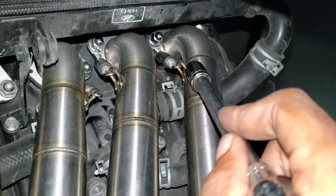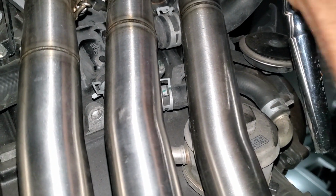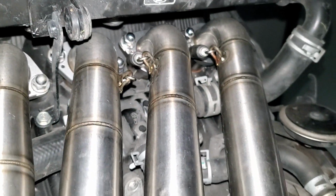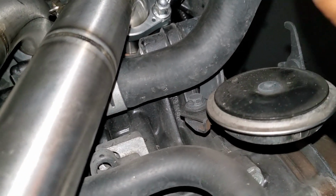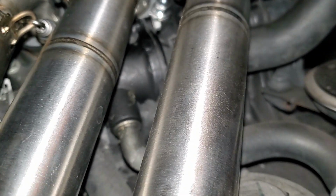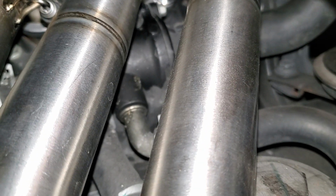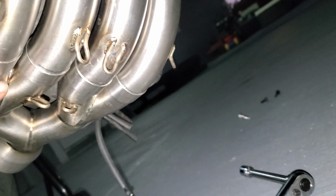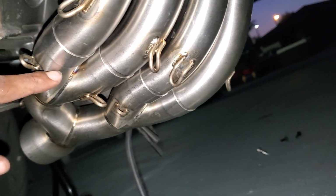All right, so now that I've gotten all of the springs on, which are right there, right there, right there, and right there, all I have to do now is just tighten down these bolts all the way. And then I'm gonna wipe them down as I go. Man, I didn't realize how dirty the bike was underneath, something I gotta work on. I looked up the specs for these. I think they're 24 pounds. I will torque them to spec. I'm just not gonna torque them to spec on camera. Oh my God, this part is the hardest part to put back.